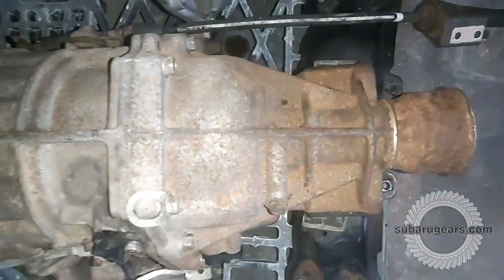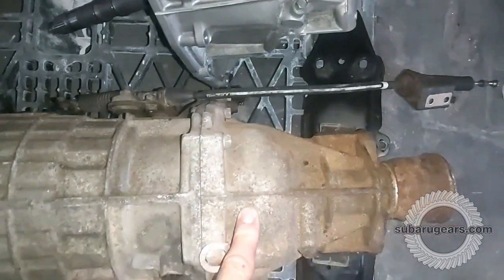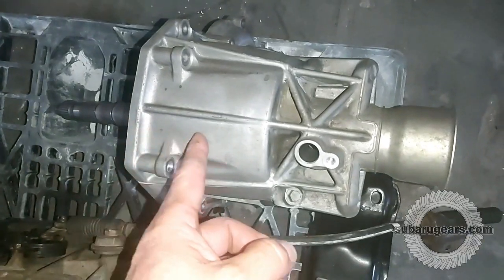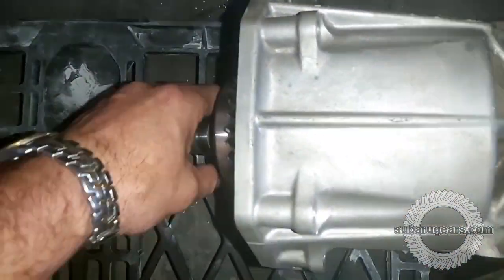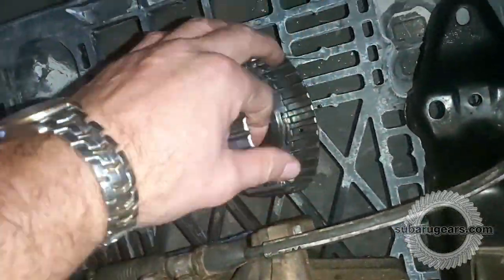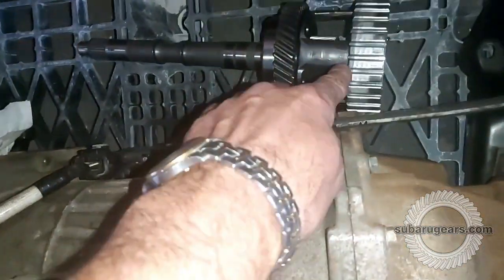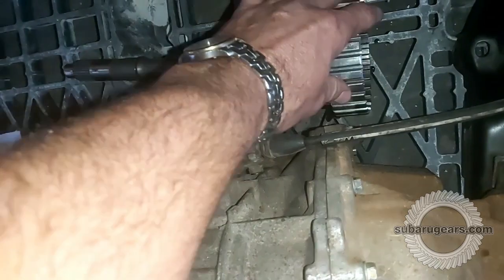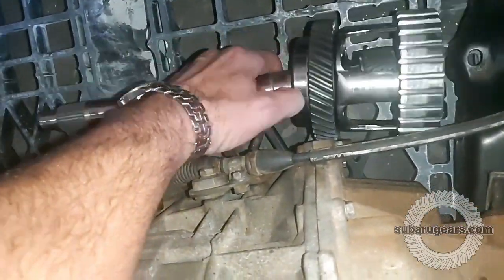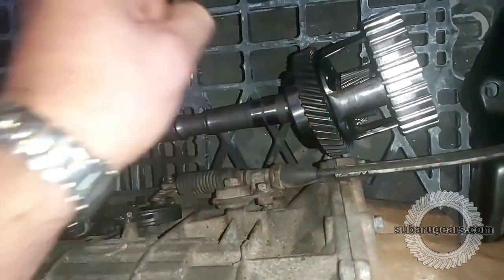One of the things you need to look at is this housing here. You can see there's only enough room for the clutch plates — it's a non-turbo four-cylinder style. The six-cylinder or turbo styles are far longer here, because the shaft they have includes a true center differential inside them, as well as the clutch plates, whereas this one only has the clutch plates. That's something to look out for because we can't modify this basket the same way we modify the other, and I'm not sure yet whether this shaft can be swapped over the same way the non-turbo one can, because of this gear.